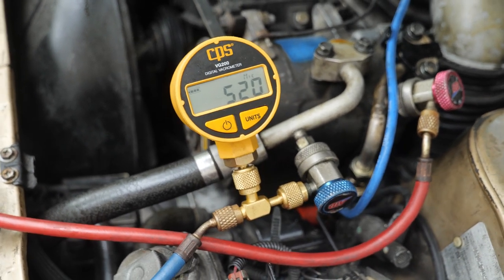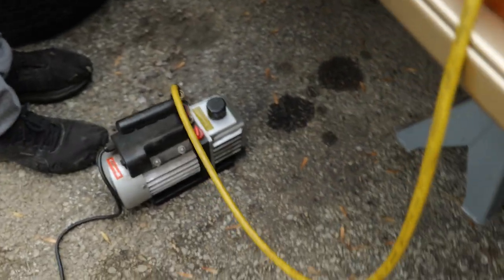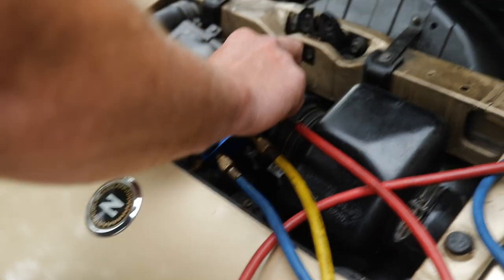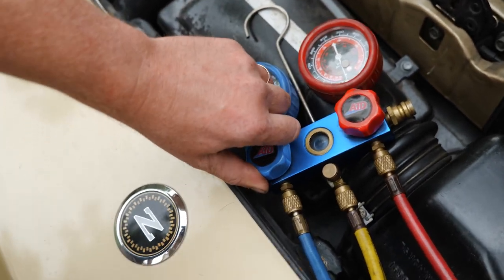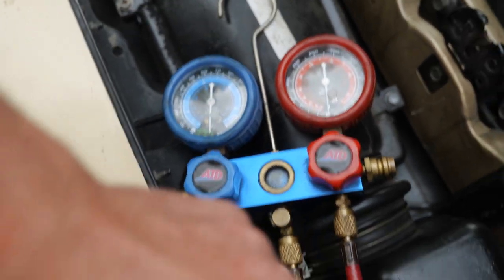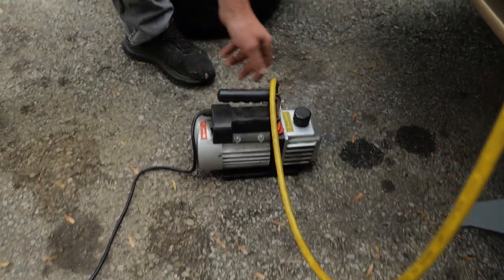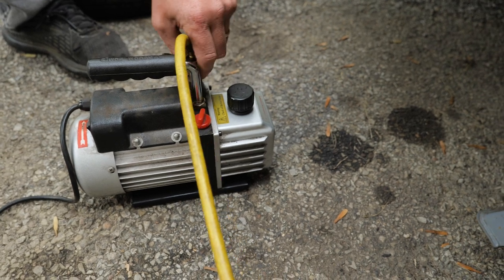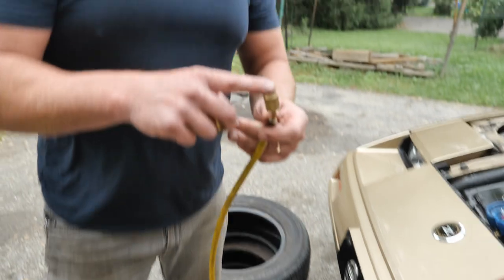If you guys remember, when we take this off of here, we want to have this compressor running. But before I do that, back up here real quick, Caleb, turn these off. I did end up opening that high side line back up for a while, and I did not pull any oil out. Gauges don't matter here. The micron gauge tells us what we need to know. Not turning the AC or the vacuum pump off. I think I called it a compressor again. Taking this off here, then shutting it off, utilizing this check valve right here.